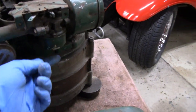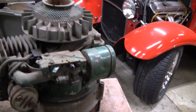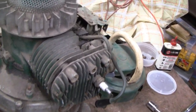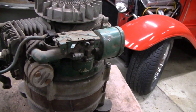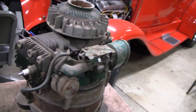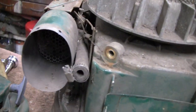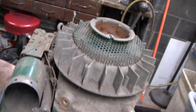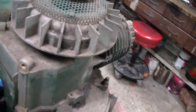I was going to take the carburetor off, but I think I'm just going to take the bowl off and look at it. From the year this is and how long it looks like it's been sitting, it probably predates the ethanol era. Ethanol fuel is really what tears these little aluminum carburetors up. Chances are if there's bad gas in there, it's just going to be old varnished gas. Taking the bowl off will tell us. Also, I checked the air filter — there is no air filter.